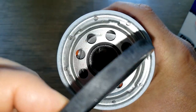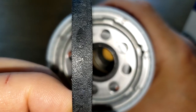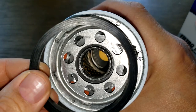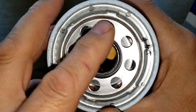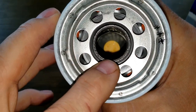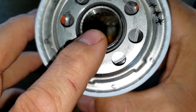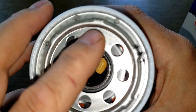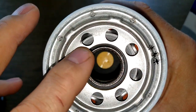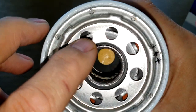It comes off fairly easy — it's a thick one though. I see eight inlet holes, bypass valve down below, and it looks like a metal core with louvers. This looks like a Champ Lab base plate, judging by these holes here and the way it's made.